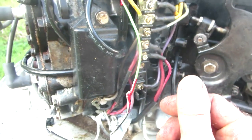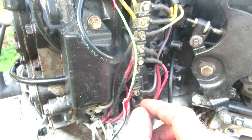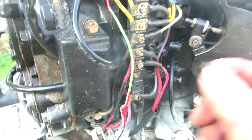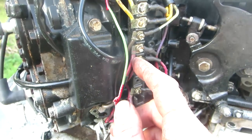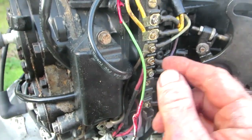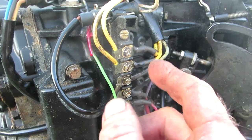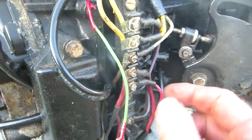Because this is an old motor — and if yours isn't a new motor you should probably do this — take every one of these connectors apart, turn the battery off of course, and clean up the terminals on both sides where the wires go together. I use about 320-grit sandpaper. It turns out my little pink wire's end on the other side was no good.